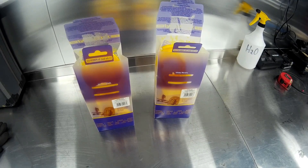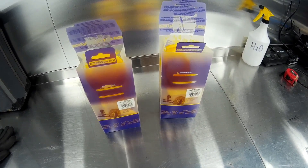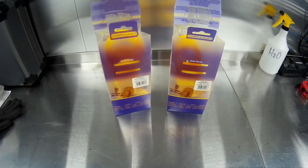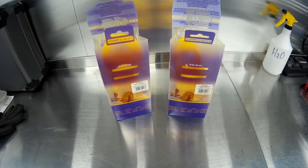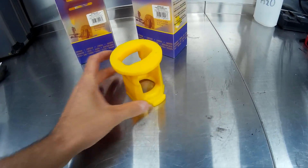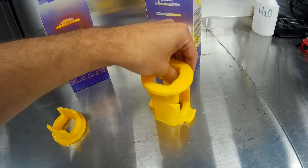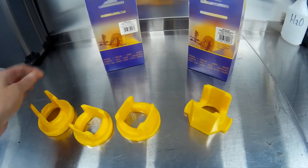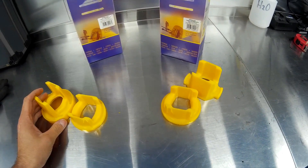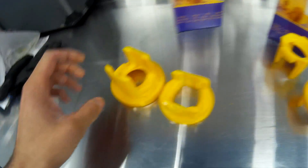After investigation I found that the rear subframe bushings, even though they are brand new, allow for a slight bit of play which causes axle tramp. To combat this, PowerFlex do a kit that will set you back around a hundred pounds depending on where you're buying from. Essentially all they are is inserts which go into where the subframe bush voids are. There are two different types — a set for the front of the subframe and a set for the rear, and yes, they really are that different.